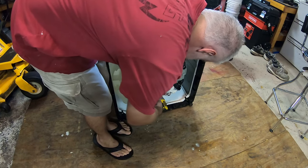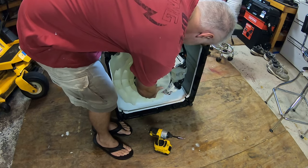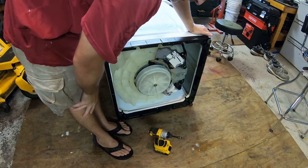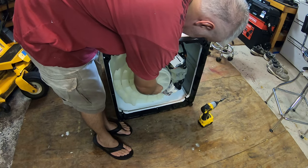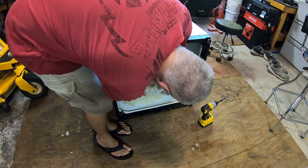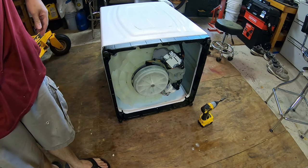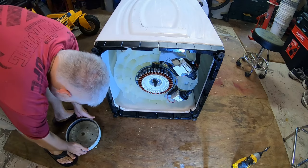Come on. Sometimes this bolt loosens up from the back and forth motion, and you'll get a kind of rattling noise. When I fixed that, I put some blue Loctite on those threads to prevent that from happening. And of course, it's duly stuck on there now, so you manhandle that off. I just jostled it back and forth and it came off.